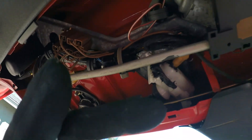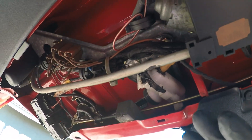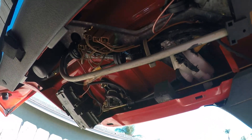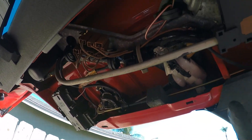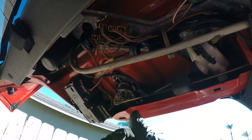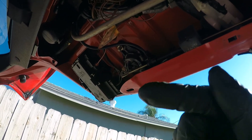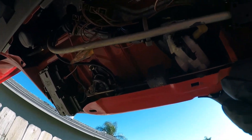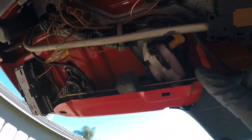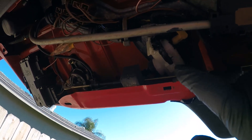This is common on the Mark III's and on the VR6 Corrado. Some G60 Corrados have them, some 16-valve Corrados, but not all. This little actuator back here — vacuum activates it and unlocks the mechanism when you use your locking fob from the driver's side door or from the keyless fob. Over time of getting slammed closed over and over again, it develops a crack right along the seam where it starts to leak.